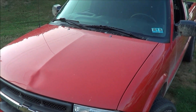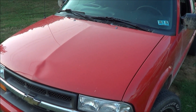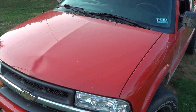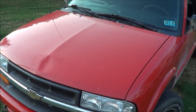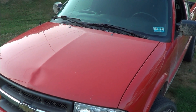I put that crank position sensor back in it. I used that gasket that I cut for a little shim, which spaced it out so it wouldn't be rubbing, and it appears that all the drivability problems have went away. Check engine light went away immediately, and it seems to run okay, starts good — so I guess that's going to be the fix.